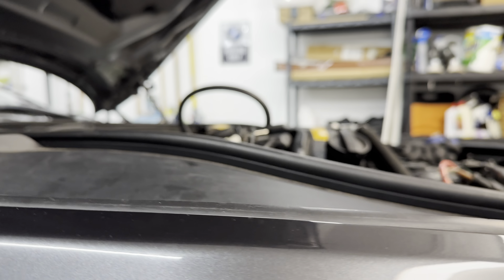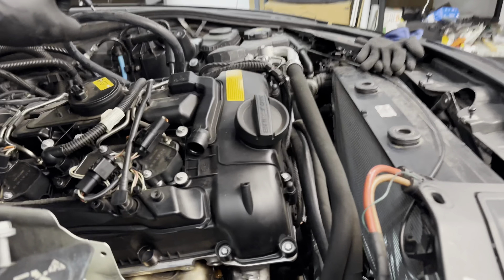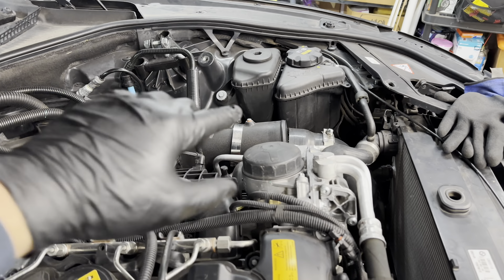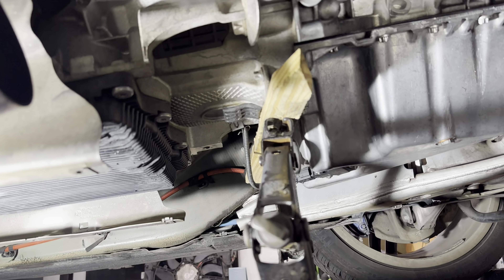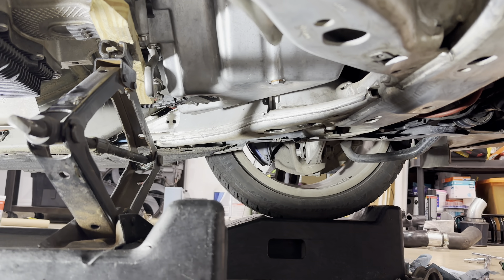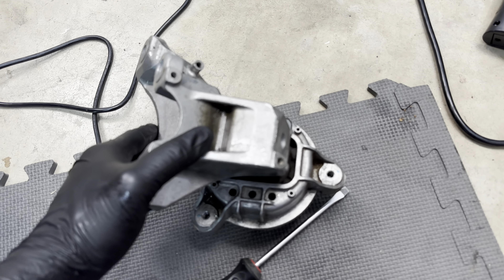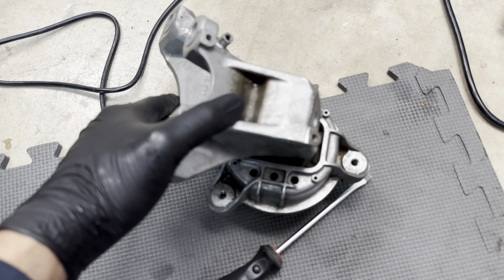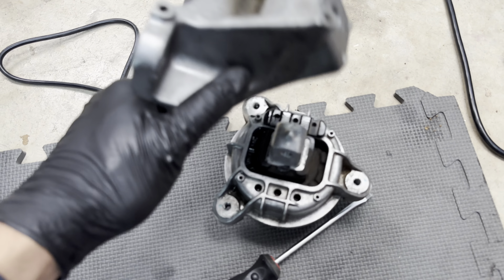After a few hours of fighting it — just to give you an idea — this is how much I had to lift the engine. I had to disconnect the charge pipe over here because I was lifting it so much it was starting to pull on that. I set it up right where the transmission and engine meet — I didn't want to do it on the oil pan itself because I didn't trust it to hold the weight. Anyway, I did all that just so I can get this off: the passenger side motor mount and bracket. The problem is there's not enough space to get it out — you either have to lift the engine or drop the subframe. They're out.